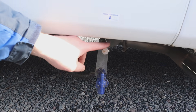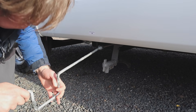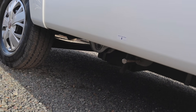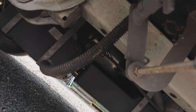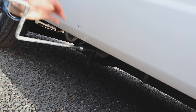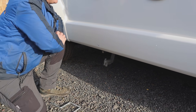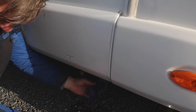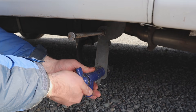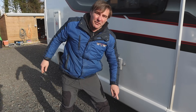Can you see the little nutty thing here? It's the same on the waste one as well - these are our waste tank fittings. That lifts it up out of the way, and then if I just put it in again and drop it down, we can drain down our waste tank. If we want to drain the fresh water down we just turn the lever - that drains it out and that closes it back up again, and that's the same for the waste tank.